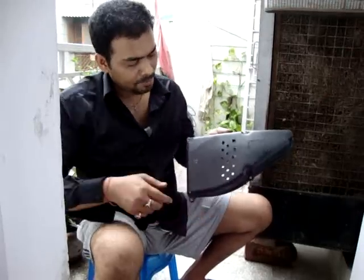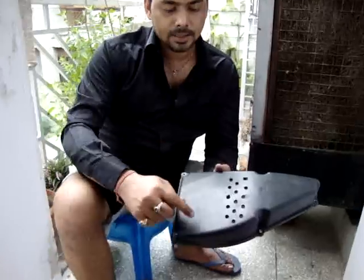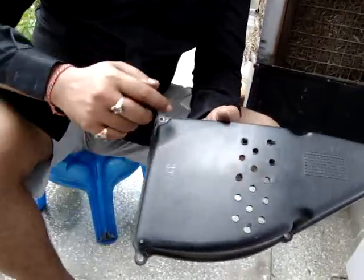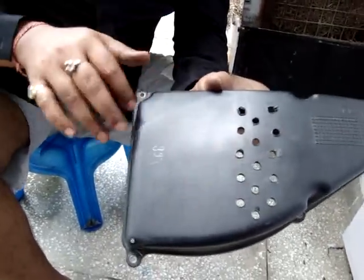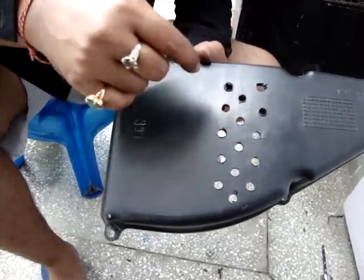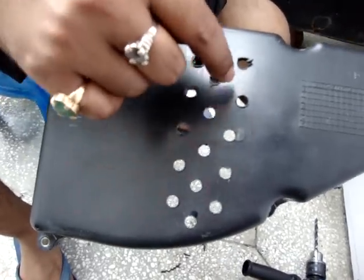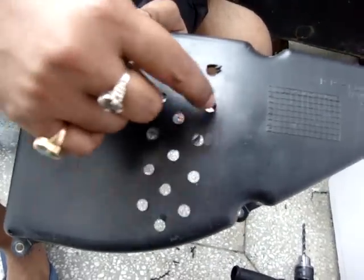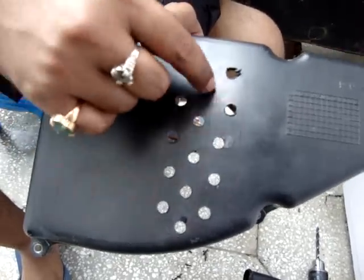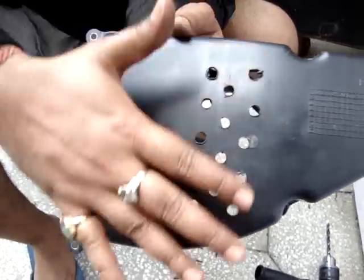Here is what I have done — I have made a grid. If you look closely, there are certain lines which have been drawn, dividing the whole drill area into small squares. I am using alternate squares: leaving four squares undrilled, so in a grid of nine squares I would have five drilled and four not drilled. That makes for an even pattern.